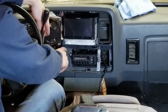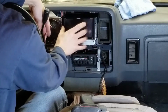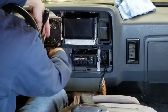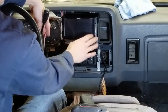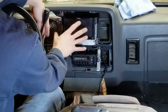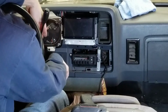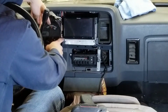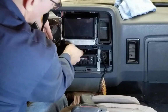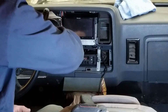One thing I forgot to mention is that you will have to make some adjustments to your structure based on the location of your head unit here. It wasn't very much, but a 1/4 inch on one side, 1/8 of an inch on the other side. Basically nip it out. We created a bracket that bolts to the head unit and screws into the front of the structure here. There's a bracket that extended off to the right of this gauge cluster that had to be trimmed up a little bit, but it really wasn't a significant issue. Okay, so what do you say we try this out and see how it works?